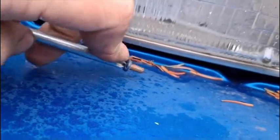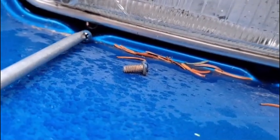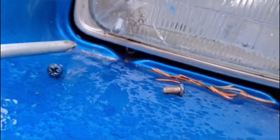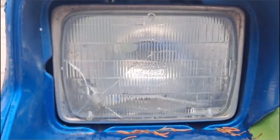Up top here, there is enough room to come in from the center. So if you're doing the right screw, you'll come in from the left; if you're doing the left screw, come in from the right. Once you have it unthreaded all the way, hold the screwdriver there, reach in with your finger, and extract it. If you release your finger it'll fall off. For the lower ones you can't really get in there, so having at least some magnetic ability on your screwdriver does become quite important — but not imperative.